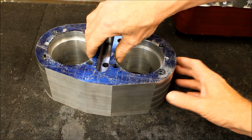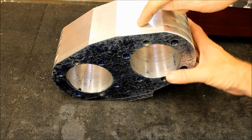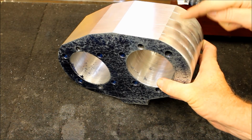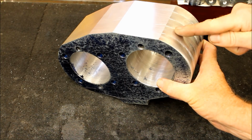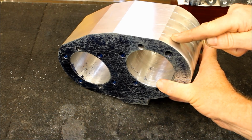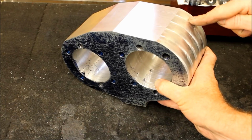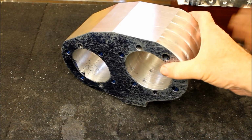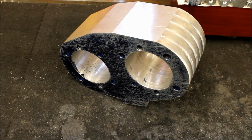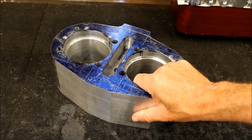What we're going to do is run round it with a ball cutter and work our distance points out, and hopefully come round with a ball cutter so it leaves the fins. I was going to think of putting 4 in it. No, 5 was better, or an odd number's better. It doesn't work that way. If you put 4 in it, you end up with 5 thick fins. If you put 3 in it, you end up with 4 fins. Whichever way you look at it, it depends on whether you want an odd number of fins or an odd number of grooves. It doesn't really matter. You're stuck with 2 choices on that one.